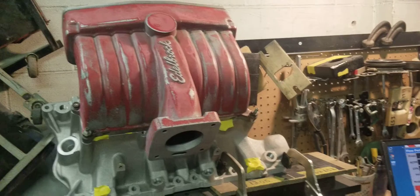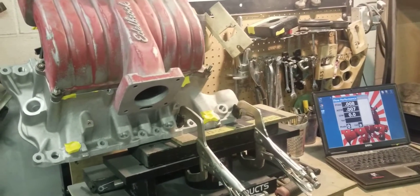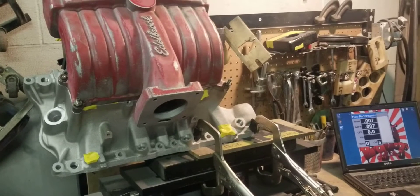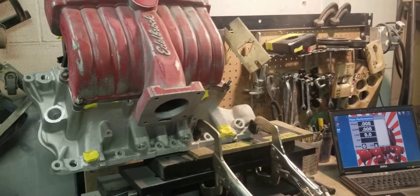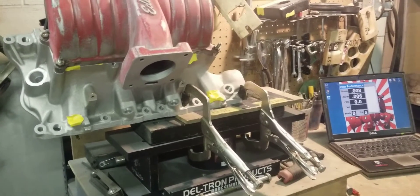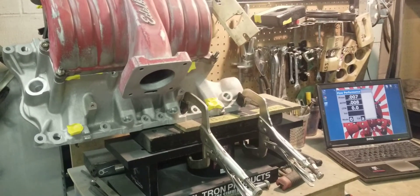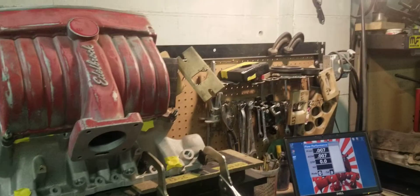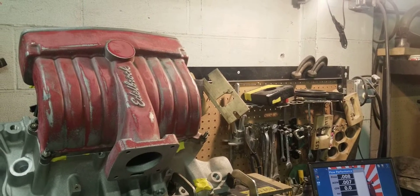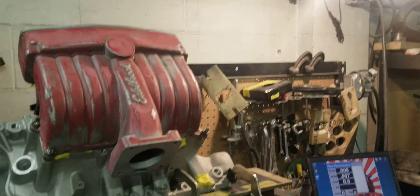But the problem is, if you guys have been watching our videos, you'd already know what a lot of enthusiasts don't know. Aftermarket manifolds are better than stock — better than bone stock factory — but they're not what you think they are. They don't flow what you think they flow. A lot of guys are going with 11R heads, AFR 225 heads, or stroker motors. Those heads can flow out of the box 280, 290, 300, 320 CFM at 600 thousandths. But you're bolting on manifolds and throttle bodies that don't flow anywhere near that. Your motor is limited by the most restrictive part on the intake and exhaust. It doesn't make a difference what head you're running if your intake manifold sucks.